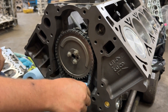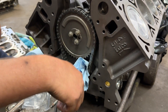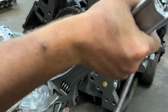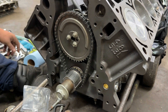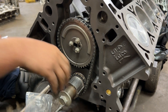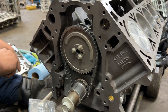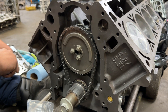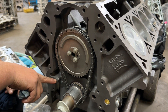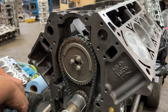That's a little trick — a lot of people overcomplicate tightening these bolts. Literally all you do is take a paper towel, shove it in there so it can't turn, and then when it gets stuck just bump it back just a hair. It's the easiest way to hold it so you can tighten these bolts. So now your cam's in. We can slide on the oil pump after we wash it, and then after that we can put the timing cover on the front of the engine.